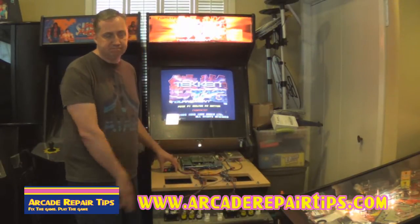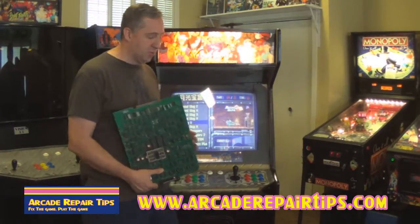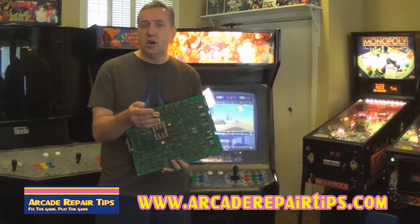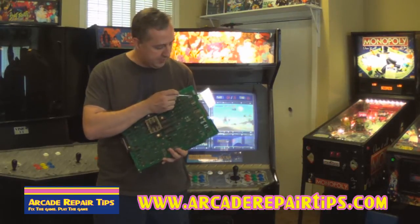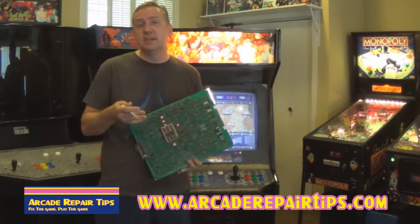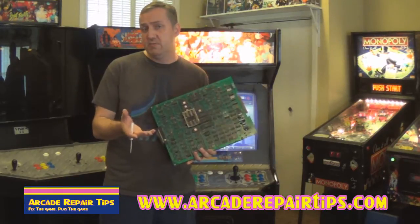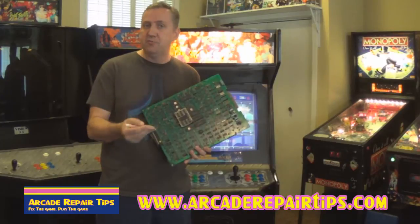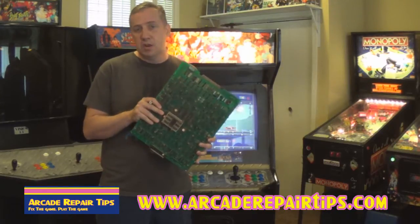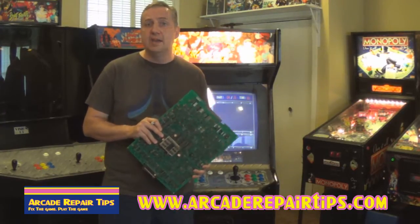Hope it helps you out. Now keep in mind if you have an older game you might not have the nice menu system — for instance this Galaga board that I have in hand. You might refer back to our video on dip switches, but on this one you would actually change some of the hard dip switches right up here. All you would do is turn your game off and move these over into whatever setting. You need to consult your manual to see whether it is a menu system or a dip switch setting or if you are even able to put it on free play at all. Therefore you might have to install a switch. Some games you just don't have a choice, but they all can be set on free play as we have shown.